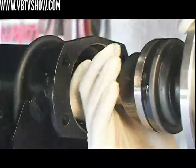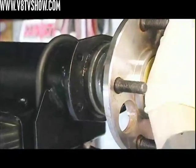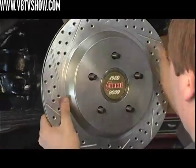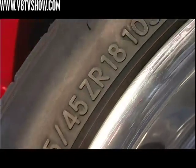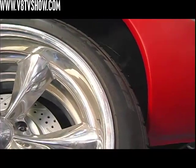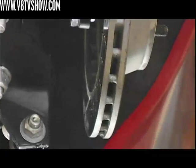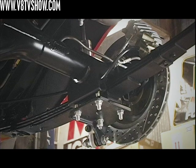These axles have an O-ring seal on the end, so we put a little bit of assembly fluid on those and made sure to insert them carefully so we didn't hurt any of the seals. Once the axle hit home, we mocked everything up using our bare 13-inch rear brake rotor, slipped the 18-inch wheel onto the rear axle, and checked clearance side to side — everything looked really nice. The next step was to install the rear caliper brackets, which are also the axle retainers, drop the caliper on, and connect the stainless brake hose supplied with the Baer Track rear brake kit.